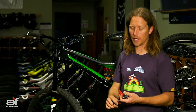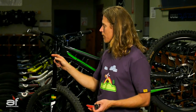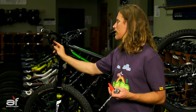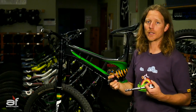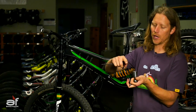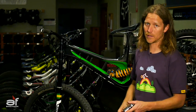It's a really simple procedure and there are only a couple of tools you need. A 4-millimeter wrench to loosen the crown bolt — depending on where the crown sits, if it's right where the top cap threads are, it'll be hard to get the top cap off, so it's easy to just loosen the crown bolt. You'll also want a torque wrench preset so you can tighten it back. And then a 24-millimeter socket — this socket in particular is modified, cut flush so all the chamfered edges are gone, which reduces the chance of it slipping off.